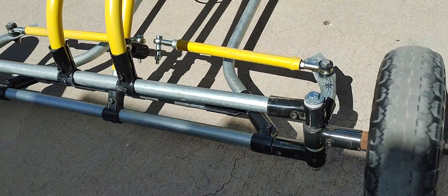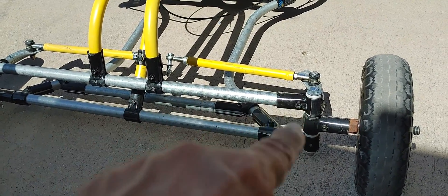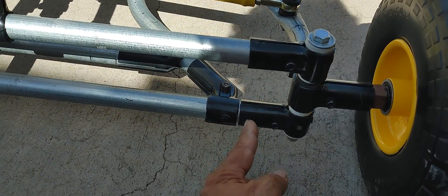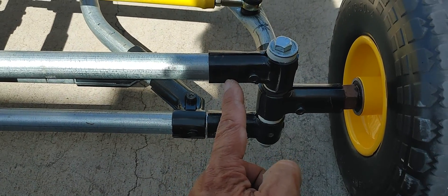The spindle support uses maker pipe connectors with a direct bolt to attach the tire. I also made new control arms — I'll explain those in a while. The main goal was to keep this nice and solid with no introduced camber, which is why I used parallelism on these rods. These wheels should have no caster whatsoever. However, because this is done with maker pipe connectors and I haven't reinforced that connector yet, under my weight these connectors want to give a little.